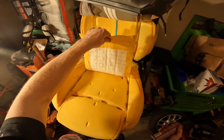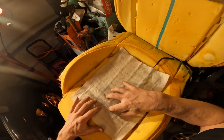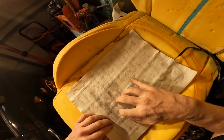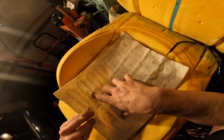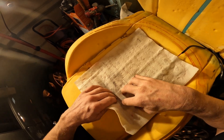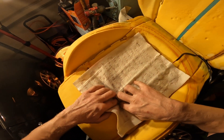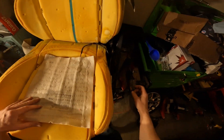Got everything rewired. Now we're going to put the heated seat in. Now in this Abarth seat, we're going to have to lay this very smartly. And we're going to have to cut slits between these so that it can go down and we can pinch the hog rings around the wires.